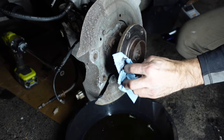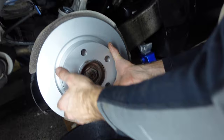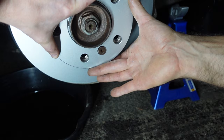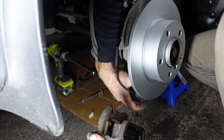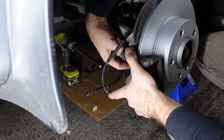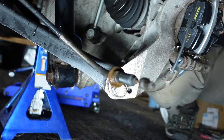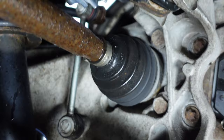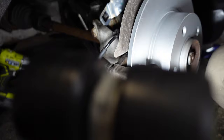The new caliper is on. Now we're gonna get the hub ready for the rotor — put a little bit of never-seize on there so our lives are easier in the future. Take the new rotor and line it up with the rotor bolts to hold it on. Then put the hanger back on with the new pads over the rotor. Get it on there, put those bolts back in using that star pattern, torqued down to spec, and now we're ready to move on to that shiny new caliper.